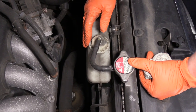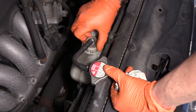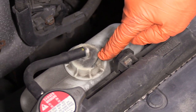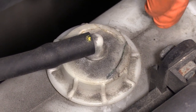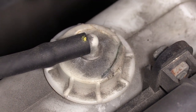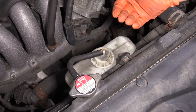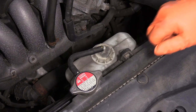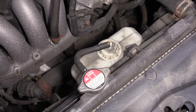Just open the overflow tank and fill it in here, not the radiator. Another thing to look at is do a quick exam of your car. If your overflow tank cover is cracked like this one, that's a good indication that this is not working properly because it works on vacuum. If you have a leak or a broken hose, it can't build up vacuum pressure, so therefore it cannot take the overflow or vacuum it back in. So that's a key thing to look at and diagnose yourself.